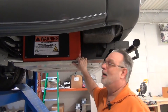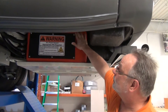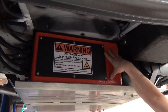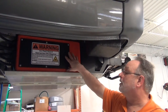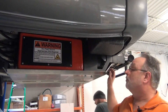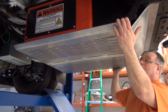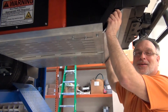This is our newest battery system. This particular van has 800 amp hours of lithium batteries. The battery storage compartment is made out of half-inch fiberglass, which provides some insulation to help keep the batteries warm. There are also heaters built inside the storage compartment to make sure the batteries do not bulk charge below 32 degrees. To protect the whole area — since it's fiberglass — we have this heavy aluminum plate skid protector with reinforcements that goes right to the frame to protect the battery compartment.